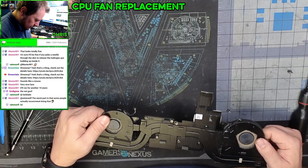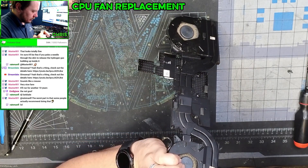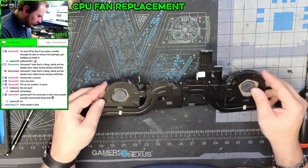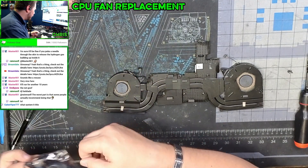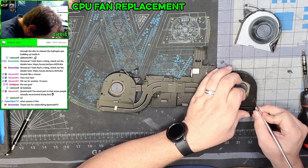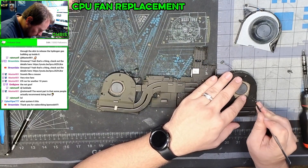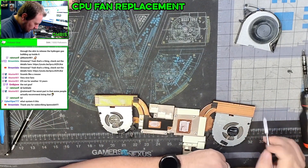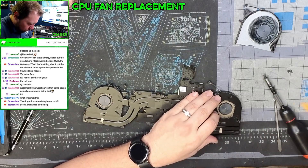This is interesting — looks like there are no screws holding this stuff together, it's just press-fit. Let me get a good look at these. This is the first time I've replaced fans in this specific computer — a Lenovo Legion. Usually on the bottom you'll have screws; this has no screws whatsoever. I wonder if I'm going to have to grind or cut these things out of here.